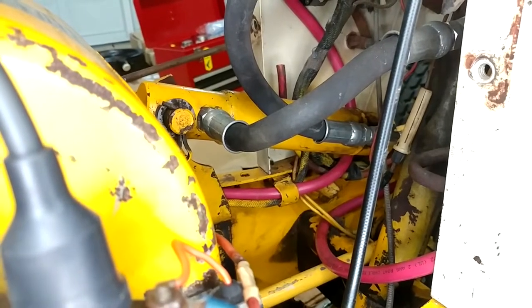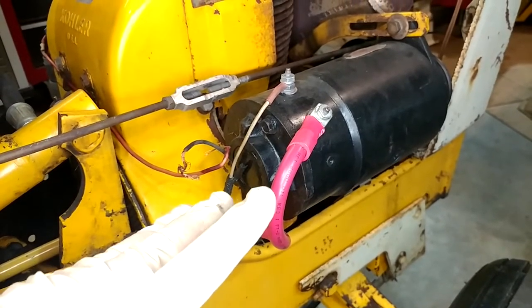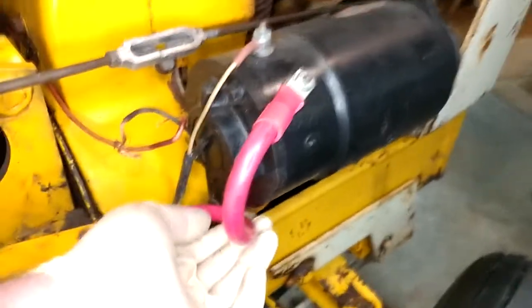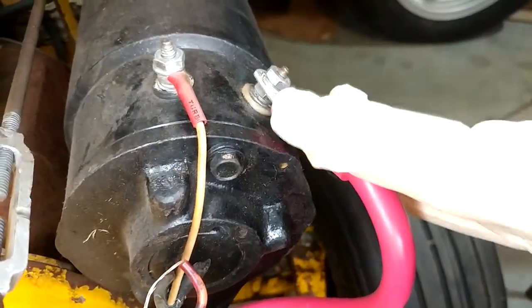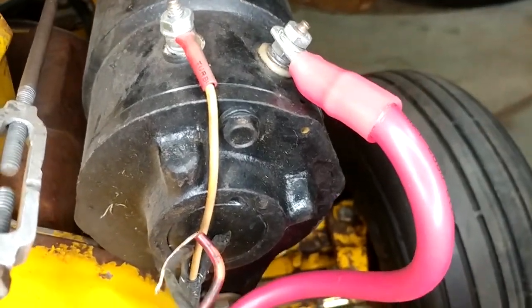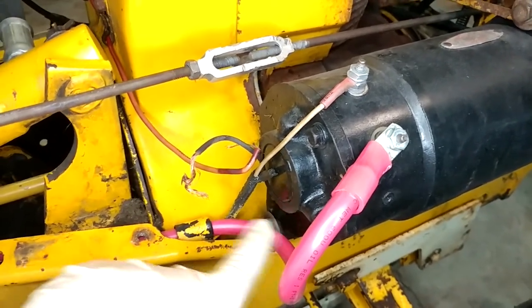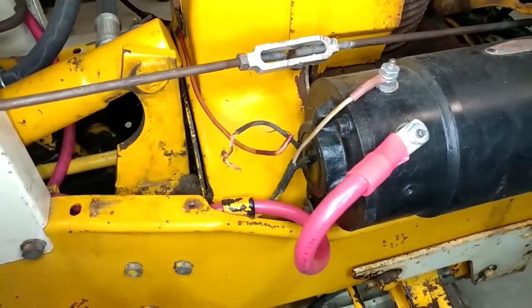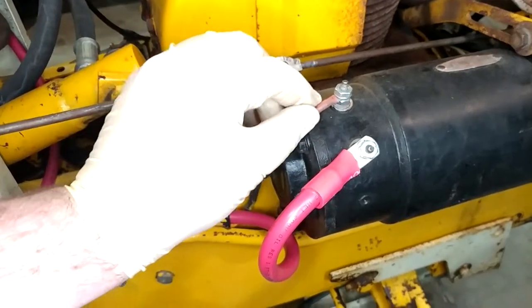The next issue is getting the wire from the rear run into the other clip. I'm pretty sure they're not going to want to run next to each other the way the original ones were. So I'm now running the back end first before continuing with the front. And looking at the starter generator, this cable — I'm now willing to admit — is too big. I wouldn't go with two gauge if I had to do this over; the four gauge would have been plenty, in fact about perfect. This is about the tightest bend I can make and it's kind of rubbing on the generator. I also had to bend the ring terminal up so it wouldn't hit the generator case and short out. Make sure this wire goes under that one — as it was in the beginning — and I'll probably tape or zip tie that again and put some split loom on it.